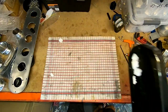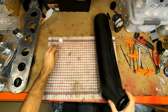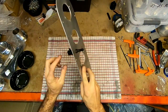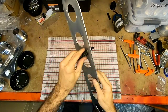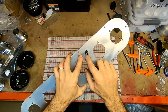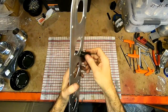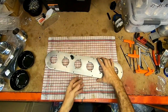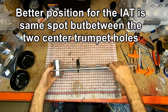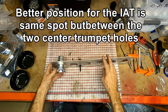Now we're ready to install the air box. First thing you'll need to do is install the air temperature sensor from the original manifold. I've simply drilled a hole in it and used a little o-ring from a fuel injector, and I had to put a washer under it. I generally like to put the air temperature sensor in this location, at the bottom front like that.